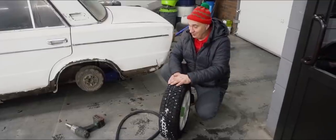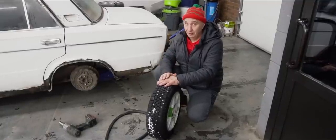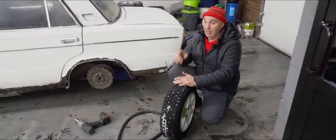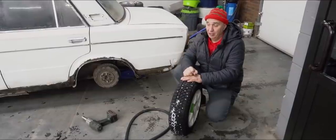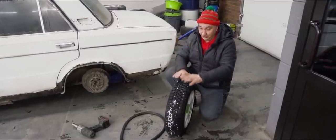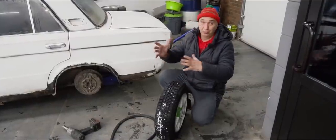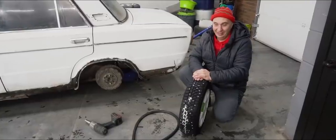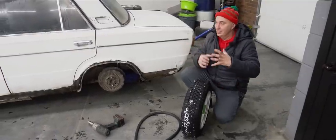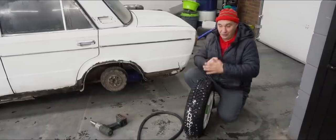These are really good tires, but our incline — well, it might not look very steep, but if you stop in the middle you're gonna have trouble setting off again. At first we'll try doing it without any load and take some measurements, for which I've prepared a scale. The idea is for the scale to determine how much pull — how much force — the rubber can transfer to the car in order to get it moving. We'll get a readout in kilos. I'm just super curious to find out how much we can gain in terms of force by adding additional kilos or even tons of load to the rear axle.